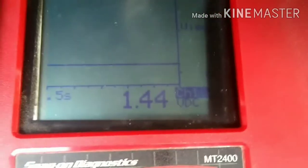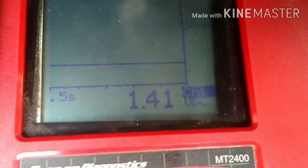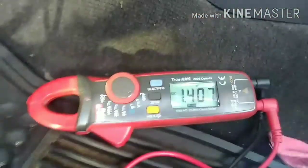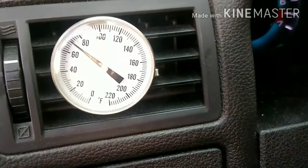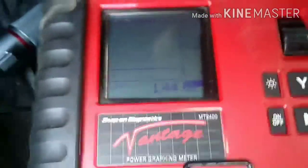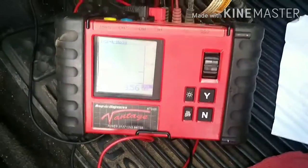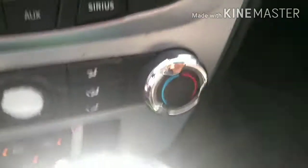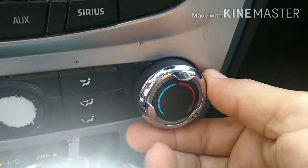When it's cold, that is what you should have — when it's cooling. Right now it's cold, but for some reason it goes to hot by itself. I have no response from the AC control module. As you can see, I can go all the way to the hot position, now back cold, and it stays at 3.56 volts — and it's going hot.